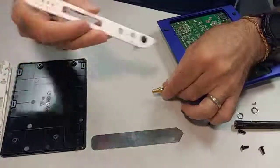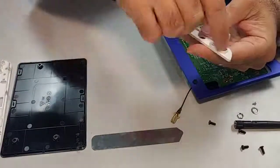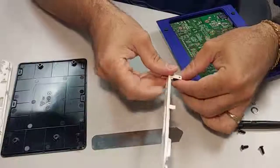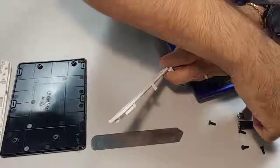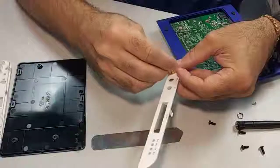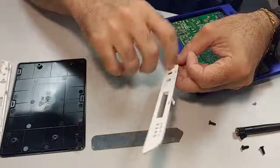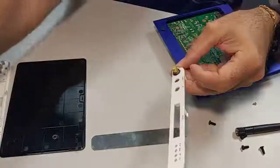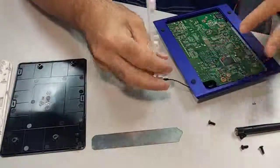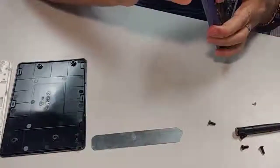Next, a little grommet — I'm going to pop the grommet out. On the back you'll notice it's the same shape. Here's the antenna screw; we'll put that in there. And we get the lock washer, put that on, and tighten that down. Give it just a little snug turn. Now we're ready to put the plate back in.